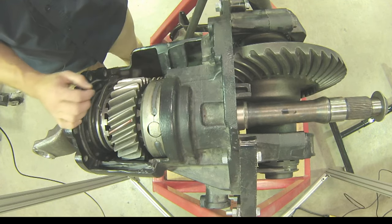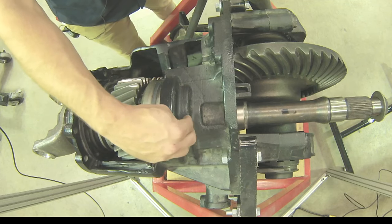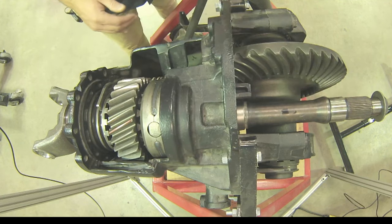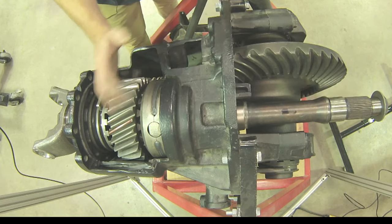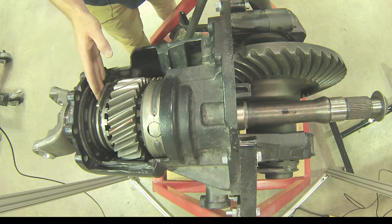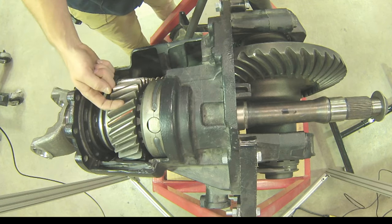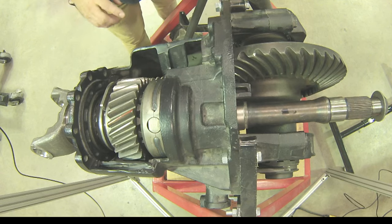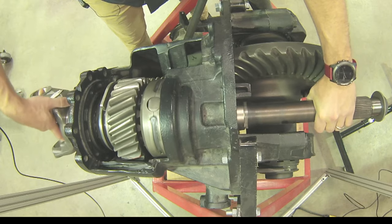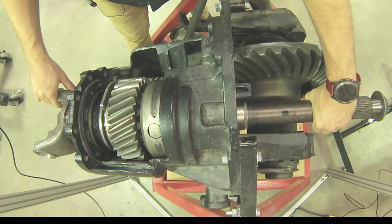It's really only one helical drive gear in the interaxle differential. What we see is that because of the differential case and the differential spider gears rotating around the stationary side gear — which in this case is the differential side gear driving the rear differential — that rear differential had traction, I was holding it. My front differential, with no axle shafts present, had very little traction, and so all the speed was directed there. When we lock the differential, moving the interaxle into a locked condition and locking the input yoke, the helical drive gear, the differential case, and the rear output shaft all together, then no matter what resistance I hold, my speed will remain the same.